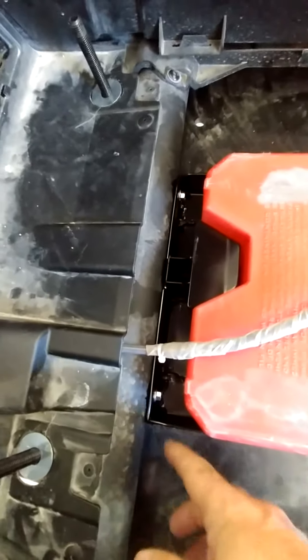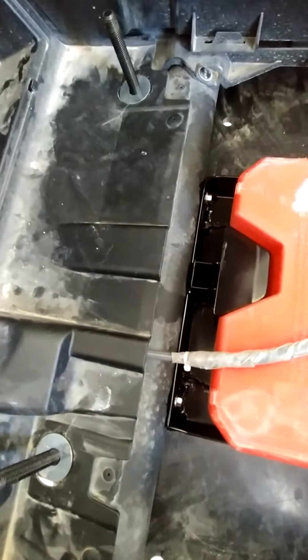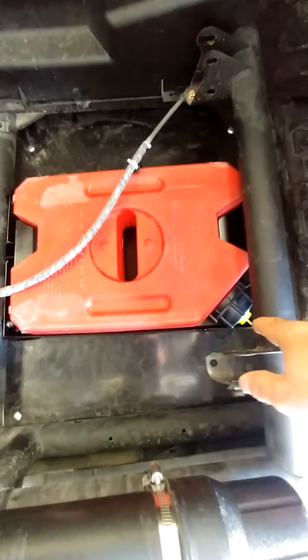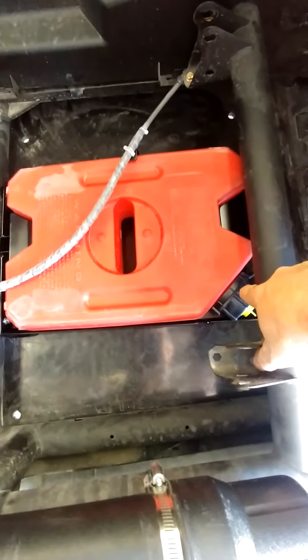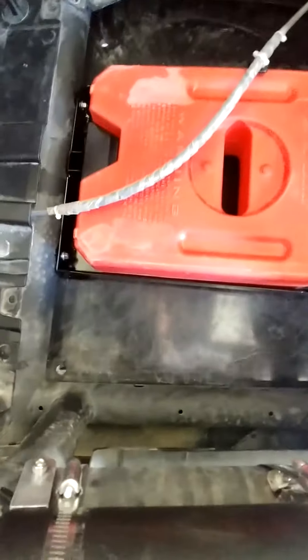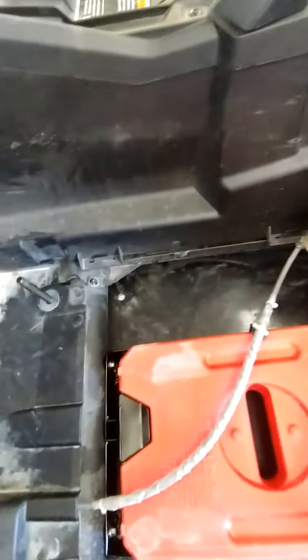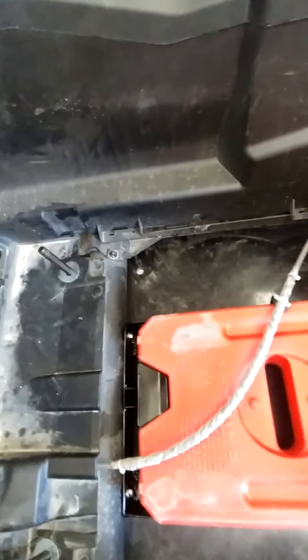There are four mount points. I use rivet nuts — two in the back, two in the front. The left side and right side are exactly the same, except on the driver's side I have the spout pointing towards the outside of the vehicle. I've also drilled a couple of extra holes in the lower skid plate so that if it has a small leak, it would drain through those holes.